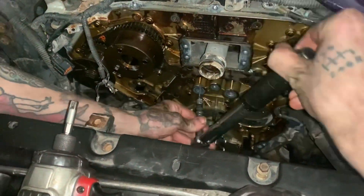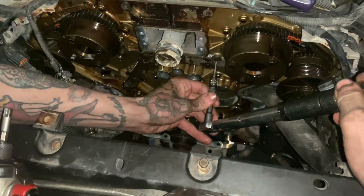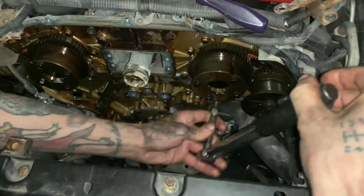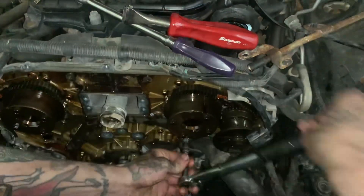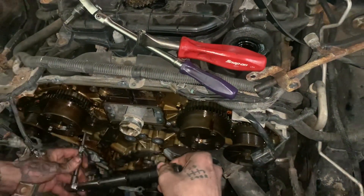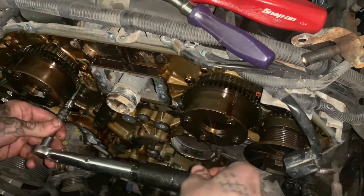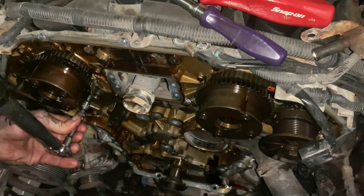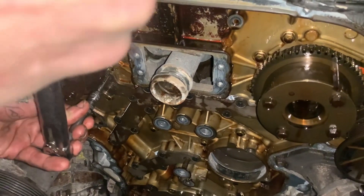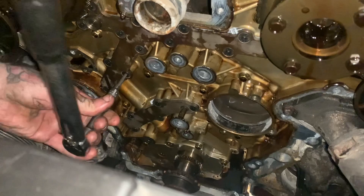And out. There is a specific torque sequence — I know EPS Tuning gaskets have their own method, but if you look at how the gallery gasket is shaped, it's not the same as a head gasket. You torque in an even amount based on how much space there is. For the final one, get right in there — perfectly torqued to nine foot-pounds. Then go back down.